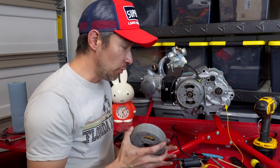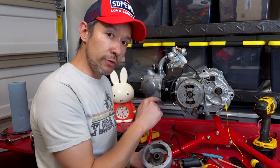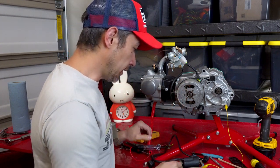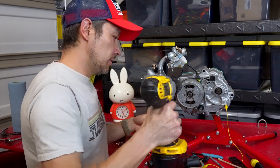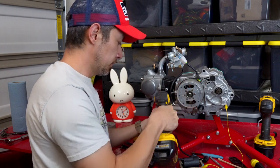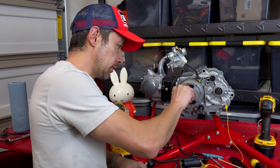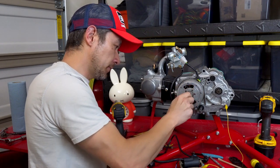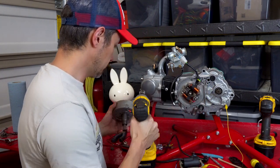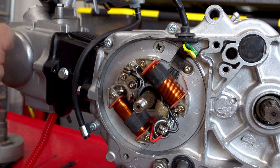The fact that I had two components for everything I tried to test is also what made this such a perplexing problem. If one of the two coils isn't working using the test light method, you need to dig into the stator itself, and to do that you need to remove the flywheel. I just use an impact wrench to spin this off, then use a flywheel puller — this threads in counterclockwise.